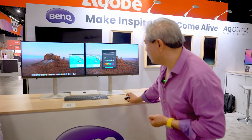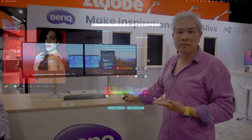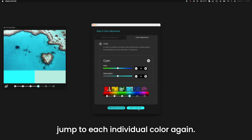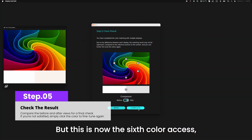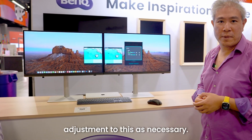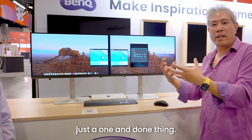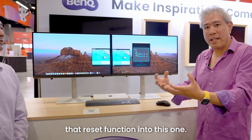Moving to the next color — cyan. Cyan's pretty close here, so you can simply go to the next color. You can always go to the previous color if needed, and at the end there's a way to jump to each individual color again, so you're never locked out of going back. If they're close to your human vision, that's perfectly fine. At the final summary stage, you can see all the colors side by side. If you don't like a certain color, click it — for instance cyan — and it pulls up the screen so you can make minor adjustments. Note that at this last stage there's no master reset, because these color corrections are interconnected — adjusting one color affects the others, so resetting one would drastically affect the overall display color.